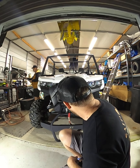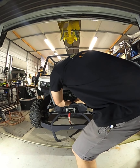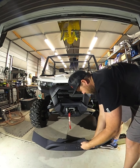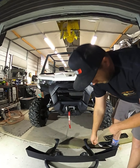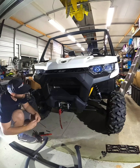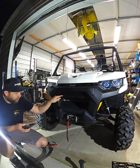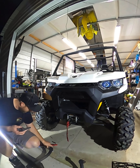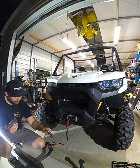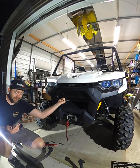We also have locking nuts, so this is going to be a pretty simple install. First thing we need to do is remove this front grill — it's just clipped in there — to expose these mounting points. This bumper has two mounting holes right here and those just happen to line up perfectly. Just a heads up: when you install this bumper and take these bolts out, it's a 13 millimeter on the back nut and the front side is a 30 Torx — so just so you know there is a nut back there, it took me a minute.